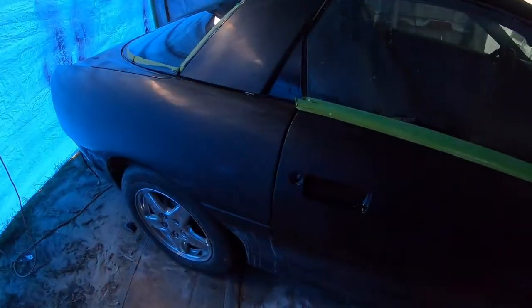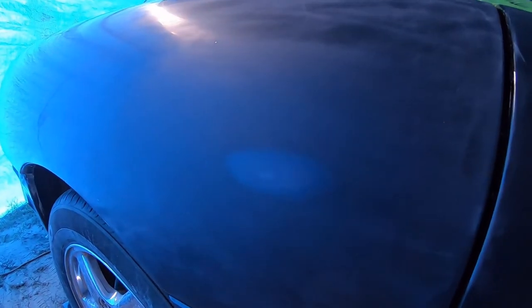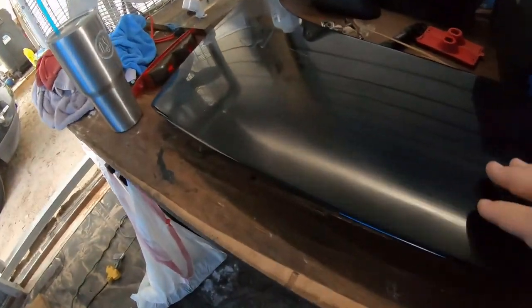Once we get the front bumper back out here we'll start painting. Anyway, I got my little mishap sanded down a little better — better feathering. We got the car back in the bay because I'm going to assemble it tomorrow, then re-clear coat the whole thing and leave it alone. I'm chasing my tail. We did compound and got some stuff looking good, but the problem is some of it has these awful scratches — we don't even know where they came from. I got trash in my sandpaper or something.